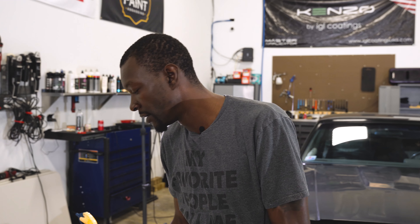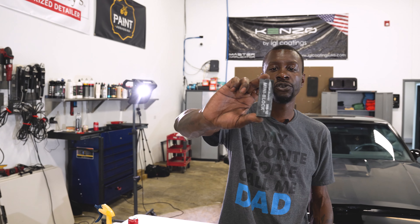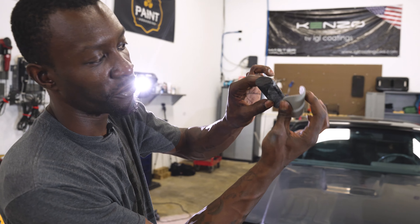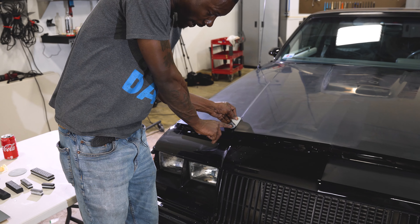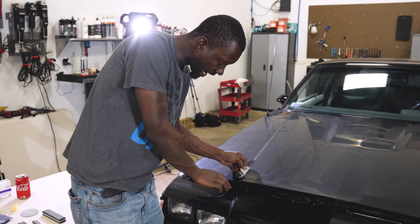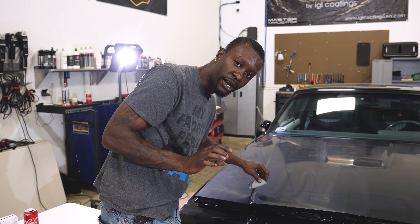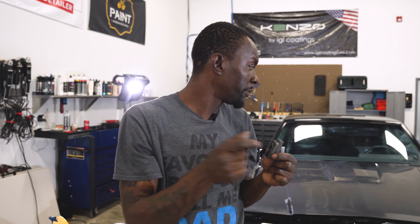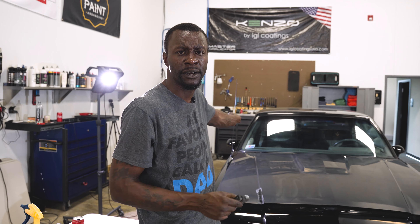On the back I have a little curved contour sanding block. To give you an idea: if I've got a smaller ridge, I would wrap the block around that ridge and come right up to that edge and sand the whole ridge. Then I have my KXK Dynamics palm block and ridge sticks — these are for very focused areas. I'll probably end up using these on areas like the A-pillar where there's a very small amount of paint, about that wide.